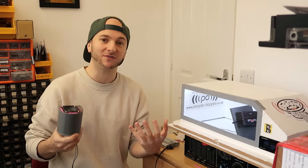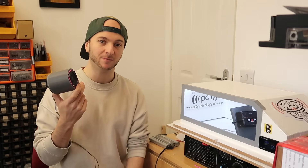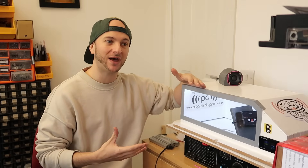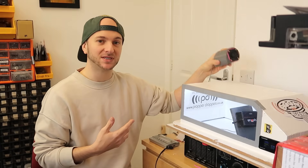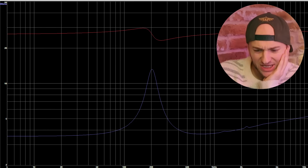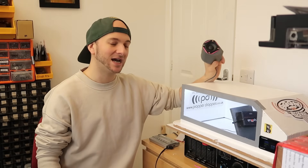If you wanted to see how adding stuffing changed it, you could model it, or maybe I could add some stuffing and post a community post at a later date to tell you how it changed, but we're just going to run it empty at the moment. While I'm not expecting this to top the charts by any means — it's a tiny small sealed enclosure — I think it's going to be louder than we might otherwise think because this test cabin kind of simulates an extreme build. It's an absolutely solid wooden environment, which doesn't really resemble a real vehicle cabin. We've already looked at the impedance sweep graph for this box in the Fibonacci 4th episode, so if you want to see what the graph looks like for this sealed chamber, go check out that video.